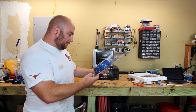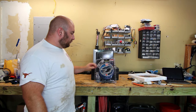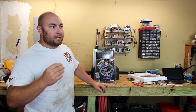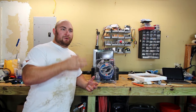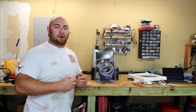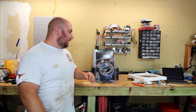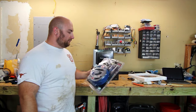This is from SoundQuest, the part number is SQK4AML. This is a true 4-gauge subwoofer installation kit. These kits can range anywhere from $25 to $100. The problem is a lot of the Pyle and Boss kits — they're really 8-gauge kits with 4-gauge amount of insulation on them, so they're not really 4-gauge power wires. This is the cheapest brand kit that is a true 4-gauge wire.